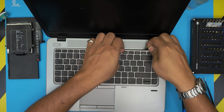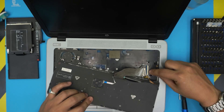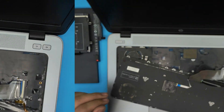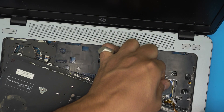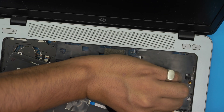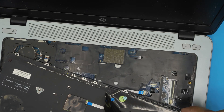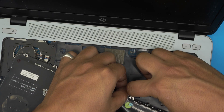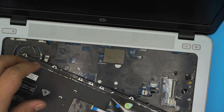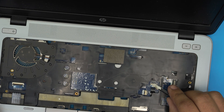Pull all the way around and lift the keyboard up and pull it out. You'll see a flex cable — lift up this flex cable by putting your finger underneath and lifting the connector cover 90 degrees, then slide out the flex cable. Do the same for the backlight cable — lift it up 90 degrees and slide it out. For the trackpad cable, do the same: put your finger on the other side, lift 90 degrees, and slide out the cable. That's the keyboard removed.